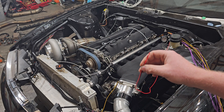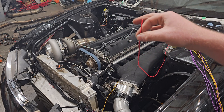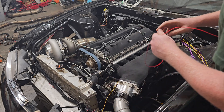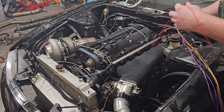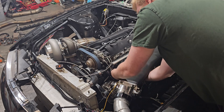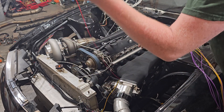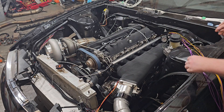So these guys right here will both go to the TPS — we'll have three wires going to the TPS. Once we get everything all situated, we're going to zip-tie everything and make it all nice and tight, and then we will start snipping to length on each of these things. Let's go up under here and take this 5V wire right here. And there's the TPS.